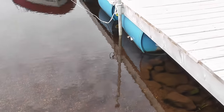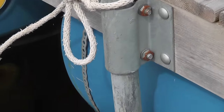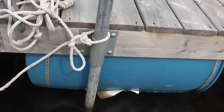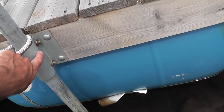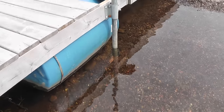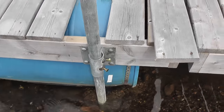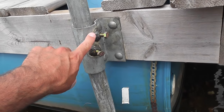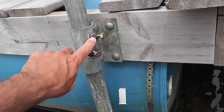This one here isn't done yet — that's what I'm talking about. I'm going to pop this off, drill a hole here and drill a hole here, as you can see I did on this other one. I'm going to replicate that more recent bracket design that didn't exist two years ago when I bought this. So I drilled a hole through this section of the bracket for the second hole, and then I took a bolt and welded it on.